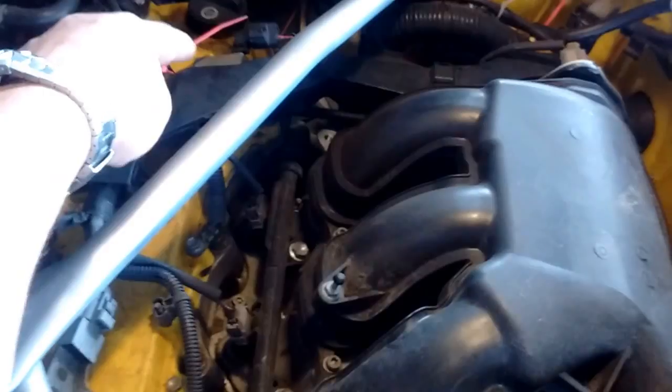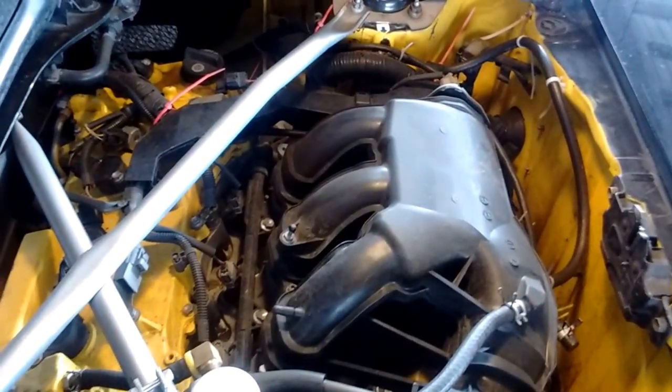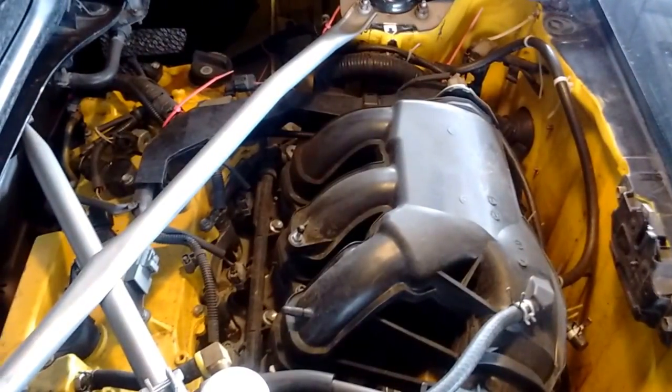The timing chain, or front of the engine, is back over there. Cylinder one being closest to the timing chain, bank one is the one that contains cylinder one. Cylinder one is actually down here under the plenum and you can sort of see where its coil is — it is closer to the timing belt than the cylinder on the other bank. Therefore, this is bank one and that is bank two.